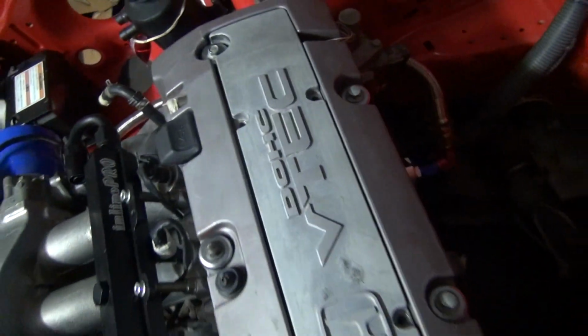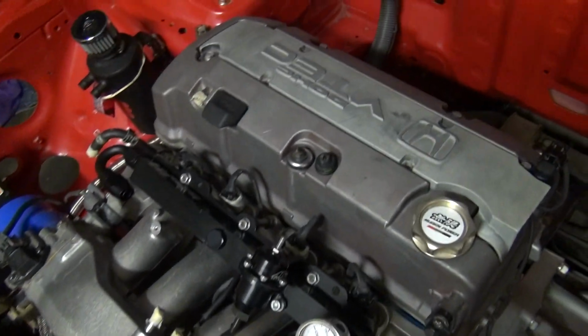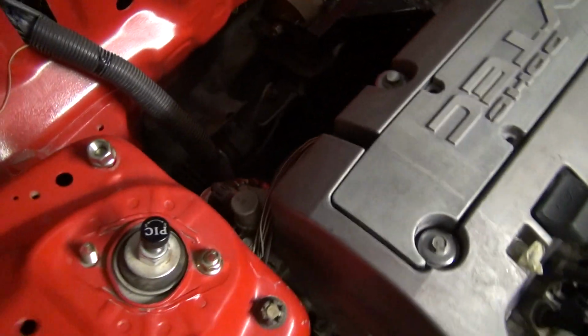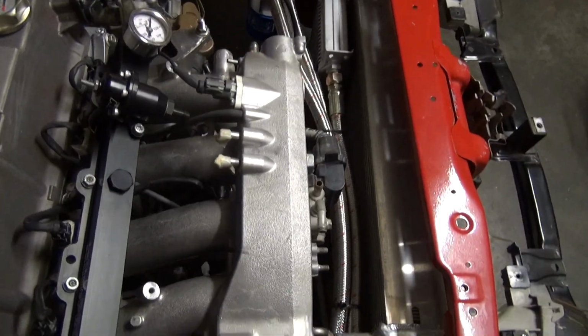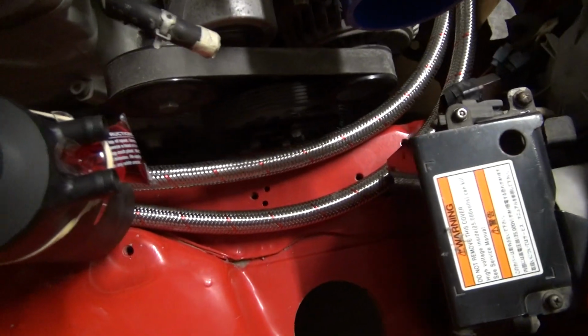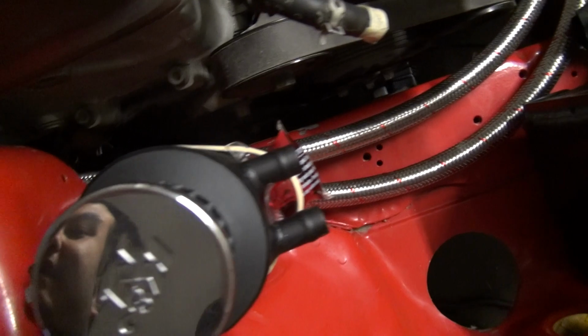There's the sandwich plate, and it's a pretty good sandwich plate. It's also got 2 bolts on it that I think are the 1/8 inch size threads, and it'll allow you to, say, do a tap for a turbo oil feed. So on the other side, the line comes that way, comes this way. I know it's just hanging out right now, but it'll definitely be braced or strapped down somehow later.